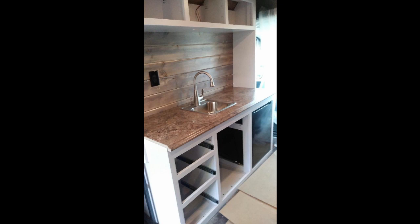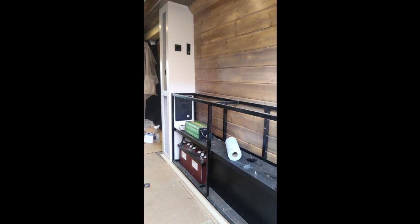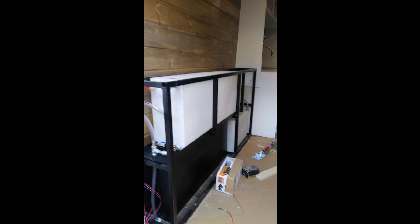On the sliding door, I used tongue and groove about 5/8 inch thick — any thicker and I probably couldn't get the door open, but it worked out well. I used poplar wood to build a cabinet carcass, and I purchased a cabinet countertop from Home Depot, cutting the back off and shortening it to fit my needs. For the passenger side, I built a steel rack that holds all the batteries and the inverter, with a little extra storage, and it also supports the bed. On the driver's side, I built another custom rack that holds the 23 gallon fresh water tank and the 10 gallon gray water tank, and also supports the other side of the bed. Both racks were later fitted with sliding doors so they look better.